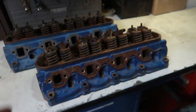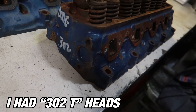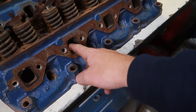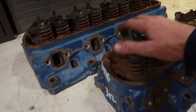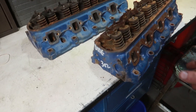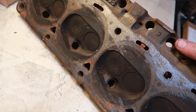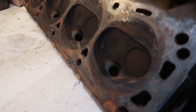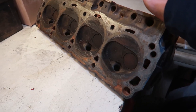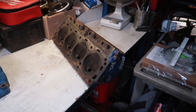Right now what we got going on is I went ahead and got DOE 302 cylinder heads. These are 1970 casting 302 cylinder heads. These have a lot larger port than what I had before — significantly larger — and the intake port is much larger with a much taller runner. This is kind of your bang for your buck, cheap old hot rod trick to get better compression. These are a closed chamber, 57-58 CC, really small combustion chamber. With the piston I'm running, this thing's gonna be like over 10 to 1, which is freaking rad — assuming everything clears, which it should.